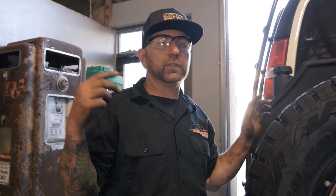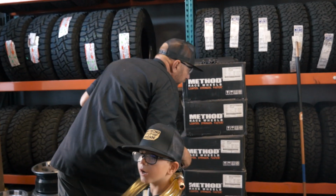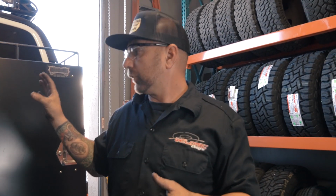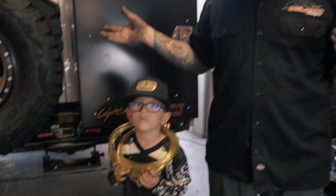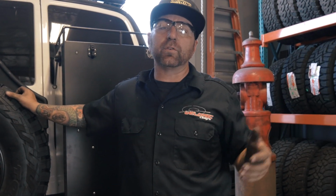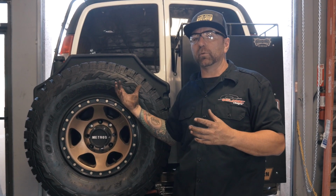I will tell you one thing that I totally forgot to include in this: it is actually made for a Jeep Wrangler. So it's not necessarily made for this 8-lug. But we just wanted it so we wouldn't have to stop for gas and could drive longer. Because of the unique design of our spare tire carrier, which is not like a normal spare tire carrier on a lot of vehicles, I did have to put 4 new holes in the Titan fuel tank mounting bracket, the bracket that mounts up inside of the fuel tank that you saw Kaiden and I installing. So I put 4 new holes in that in order to go to our spare tire carrier mount.